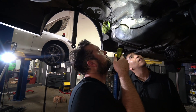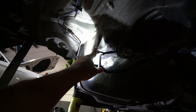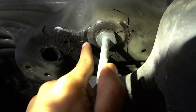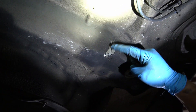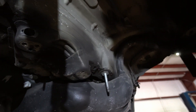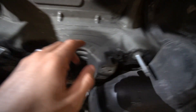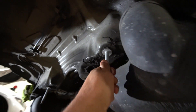Repair then reinforce — that's the process. Luckily I caught this now. I refused to drive the car for the last two weeks because I was afraid of it getting worse. It's not at the point of no return, but it's pretty bad. Remember, this car was equipped with the SMG transmission, which is very tough on the subframe, plus 175,000 miles. If this fails completely while you're driving, it could be a very big issue. Subframe reinforcement is a must for any E46 BMW — skipping it could end up costing two or three times more to fix later.